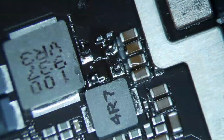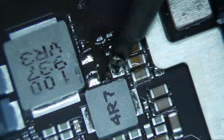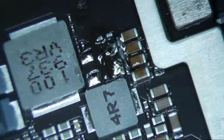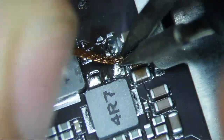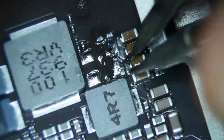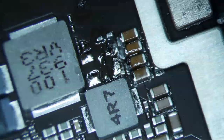I'm going to remove these two diodes and clean this up a little bit. I don't want that much solder on them and it should not be bridged, so I need to fix that. I never really want to bridge stuff because it just takes forever longer to fix it.